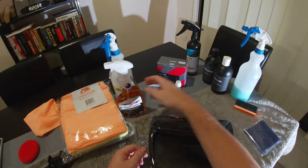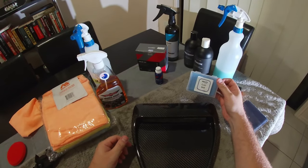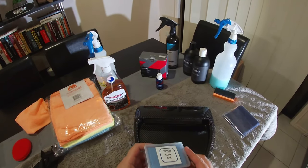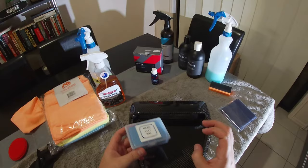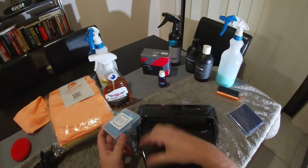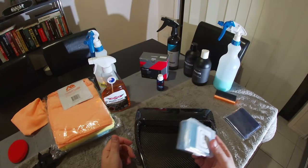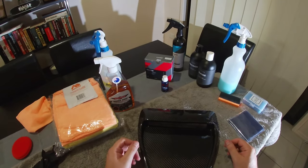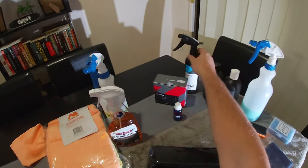After giving it a clean we would then move on to clay. Since we won't be doing that today we'll skip it, but if you haven't used a clay bar before, you buy them in a kit, break off a piece, lubricate it with clay lube or a car wash solution, and just rub it in until it feels nice and smooth — you know the grit is away. But we're skipping that and the polishing stage today.